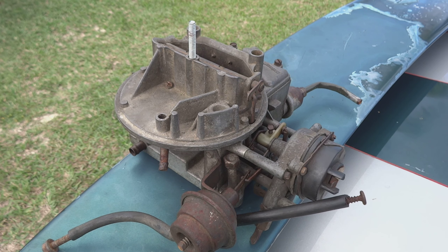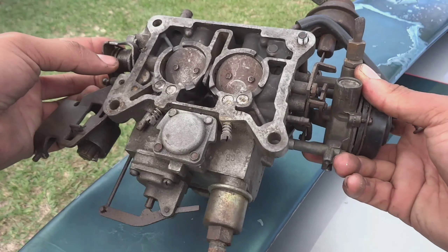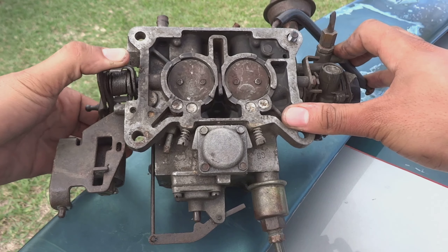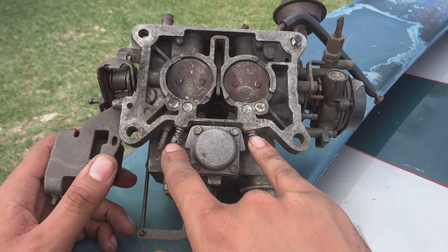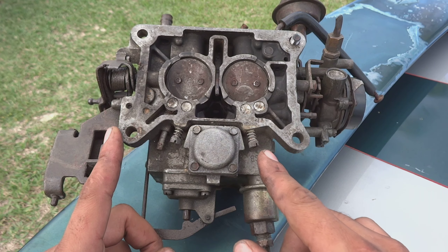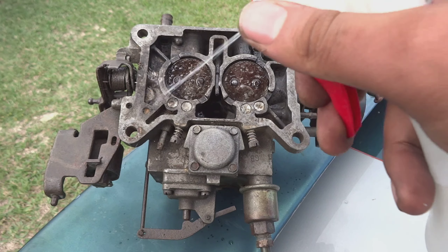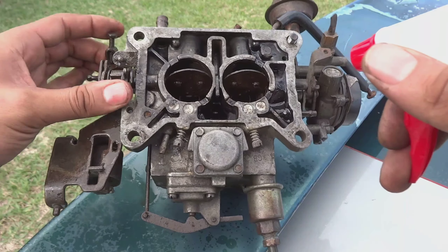To get started cleaning up that throttle, even though it started to open up with a little bit of force, I'm going to flip this carburetor over and expose those throttle plates. While I'm doing this I'm also going to be setting my air-to-fuel mixture by screwing these mixture screws in all the way and then backing them out two full rotations — I read that's a pretty good base mixture to start with. First I'm gonna get a little WD-40 on those throttle plates to grease it up and get it moving.